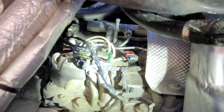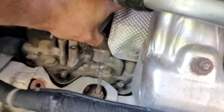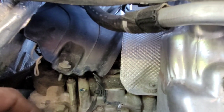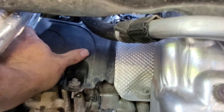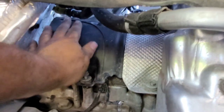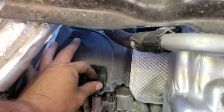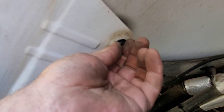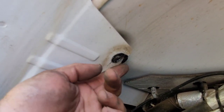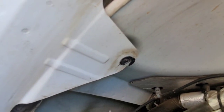When you're getting ready to put the plastic cover back in, just tip it up like that and it should slip right up under. The bolt is in the way — right up under just like so — it's snapping into place. Then just tighten this down with a 10 millimeter. It's really hot. I'm not going to bore you with putting the inner fender liner back in — it's just a bunch of Torx bits. I did have to cut this bolt out a while ago with the grinder; the head was stripped out. So I'm going to knock that off and get back on the road.